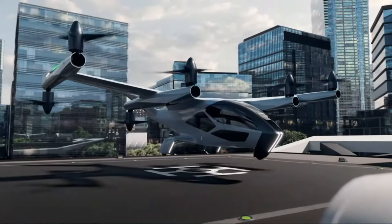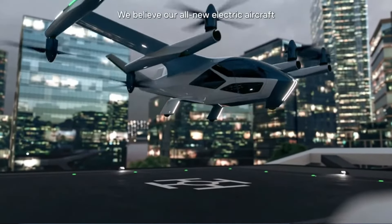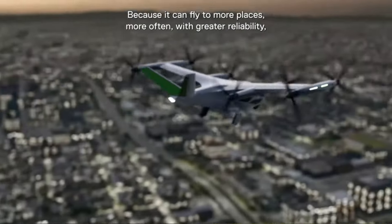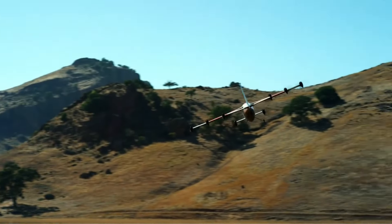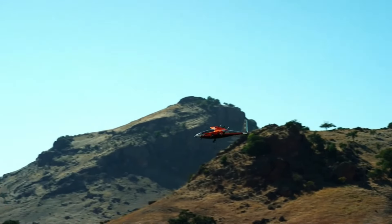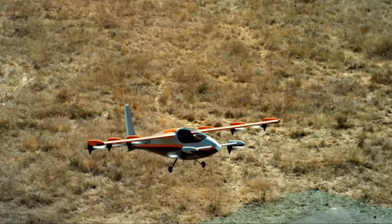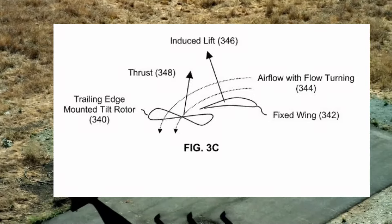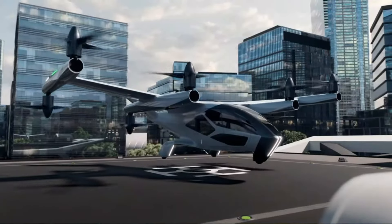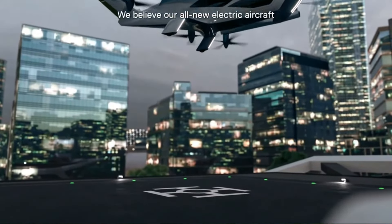In the Supernal AS2, downward-facing propellers assist during vertical flight modes, reducing the power required. When in forward flight, these rotors tilt to become perpendicular to the direction of travel. It's worth noting that the Kitty Hawk Heaviside, one of the most efficient eVTOL aircraft and the earliest model to demonstrate a 100-mile range, had all of its lifting rotors tilted downwards, which also enhanced wing lift during hovering. The Supernal AS2 applies the same principle, with its wing benefiting from the lift generated by the downwash from the downward-facing rotors.